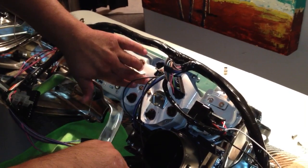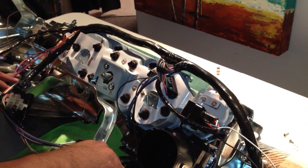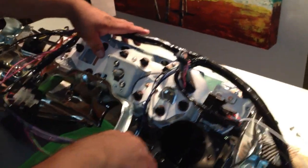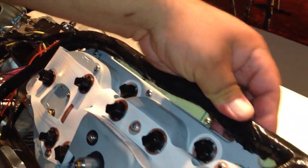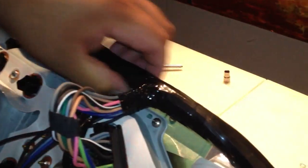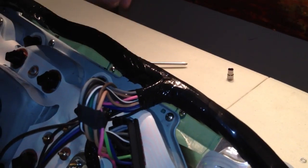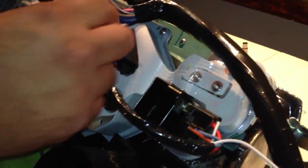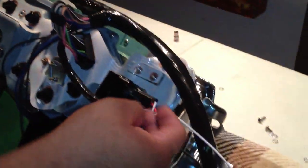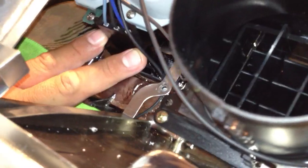We're on to the next phase of our SS dash conversion, which is the wiring. We started mounting the main wiring harness. It mounts using the original clips that mount to the gauge cluster housing. Plastic wire clips are taped into the harness, so those are perfectly mounted on there. We mounted it to the printed circuit board, just like factory. We mounted our headlight switch plug, our wiper plug, and our cigarette lighter plug.